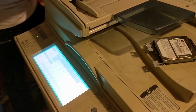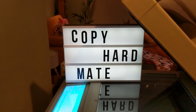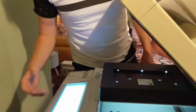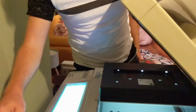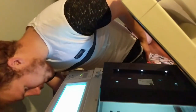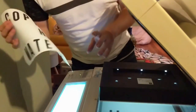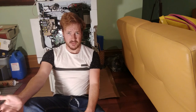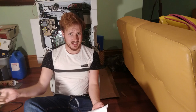We're going to photocopy something just for the fun of it. This is what we're going to try and copy — note that it's mostly white. The copier still tends to jam if I try to copy something that's incredibly black; I think that's due to toner sticking to the fuser, but that is beside the point. Oh yes, that is delicious — that is so damn cool! So in the end it turns out if you have a failing hard drive in your Ricoh copier the machine just won't start at all, but if you take it out suddenly everything's fine. I think that's a bad design on their part, but hey, at least we solved the problem. I still can't figure out why the copy is jamming on all-black pages but I'm pretty sure it's the fuser.